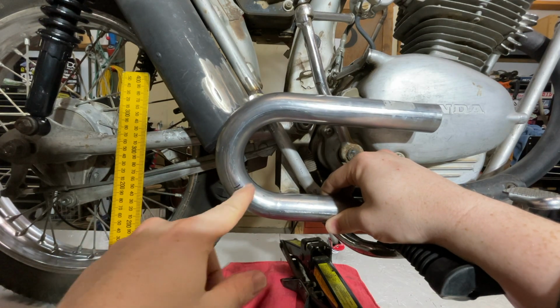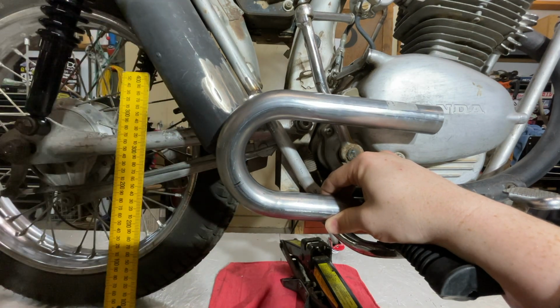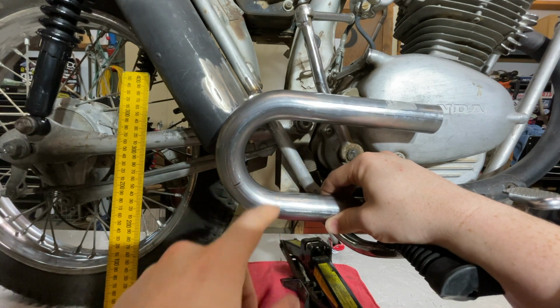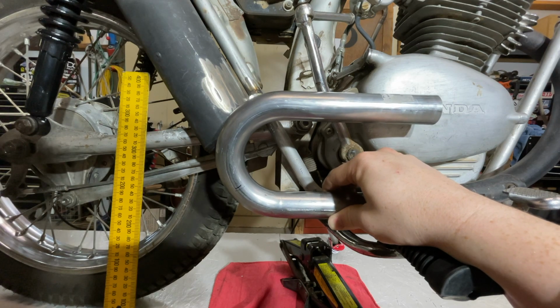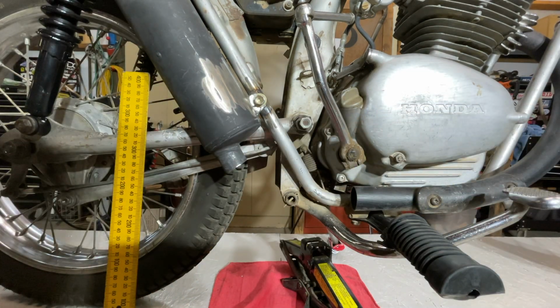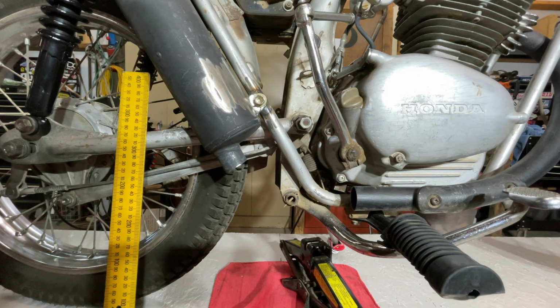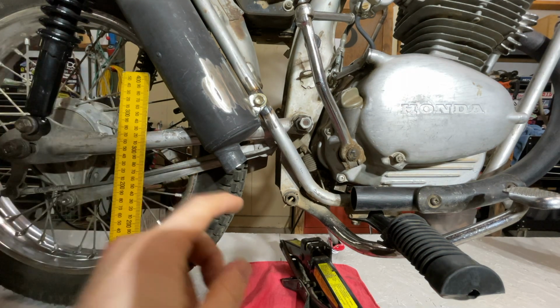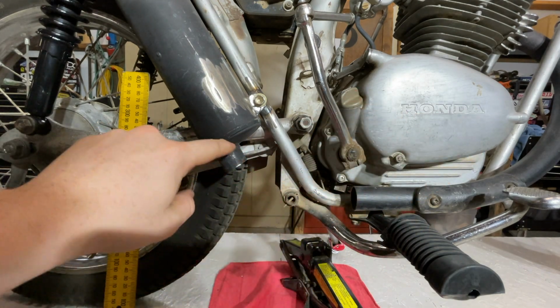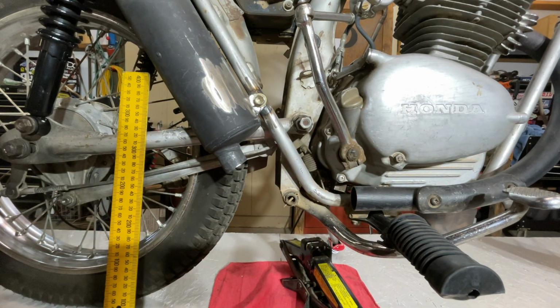This is where that line, I think, is perpendicular with the length of the muffler and straight through this U-bend right here. And we probably still are gonna have to add like a 1 inch straight piece in there, just to prevent there from being any kink. So it should be just a straight curve right up there without any hard corners.